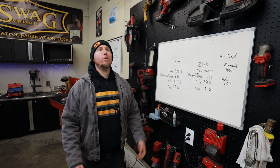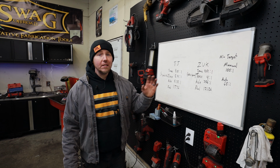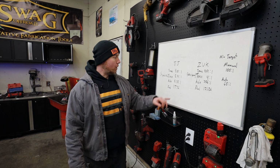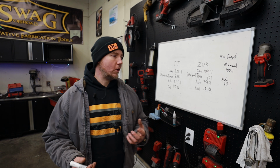It wasn't so slow that it was worthless, because some people will get 200, 300, like crazy low, but I never found it necessary to go any lower than this. This made it, especially with the diesel engine, feel like an on and off switch with that clutch. I never smelt clutch from having to burn it up when crawling big rocks or obstacles.